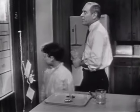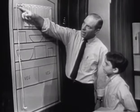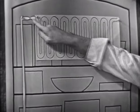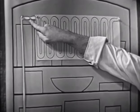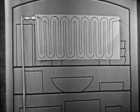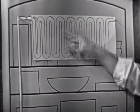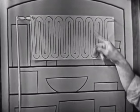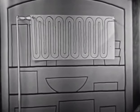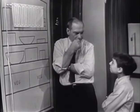Now let's look at that diagram up here again. We'll start going up on this tube right here — this is a liquid under pressure, and when it gets right there, the pressure is suddenly released because it can now go faster. See how it's all sort of pinched here and held back? Now what can happen to the liquid when it goes through here? It expands. So it absorbs heat — takes the heat away from the food. The liquid in it that hasn't expanded is also evaporating, so it takes heat from here also. We've now taken the heat from the food. That's the refrigerator.